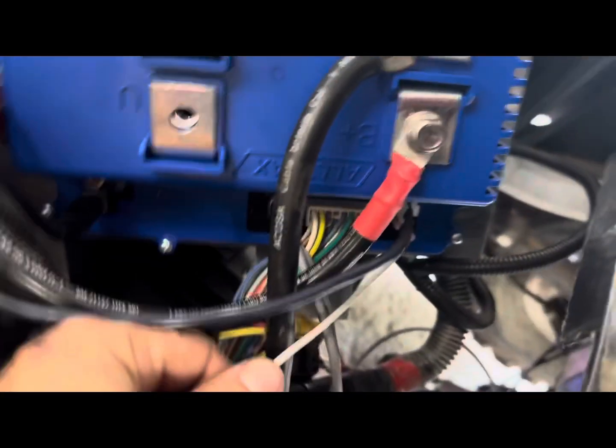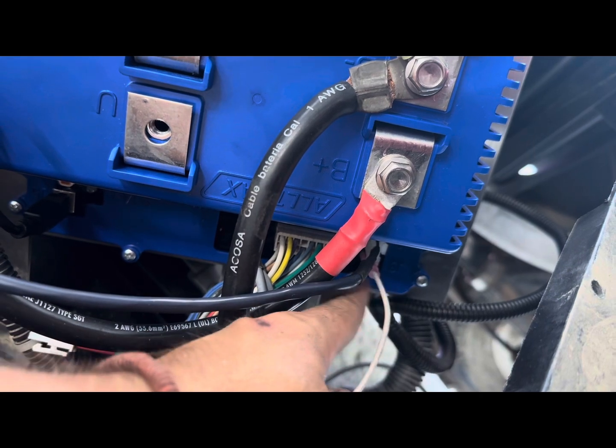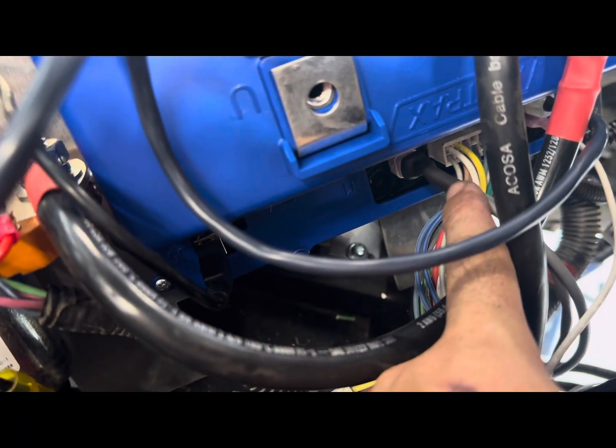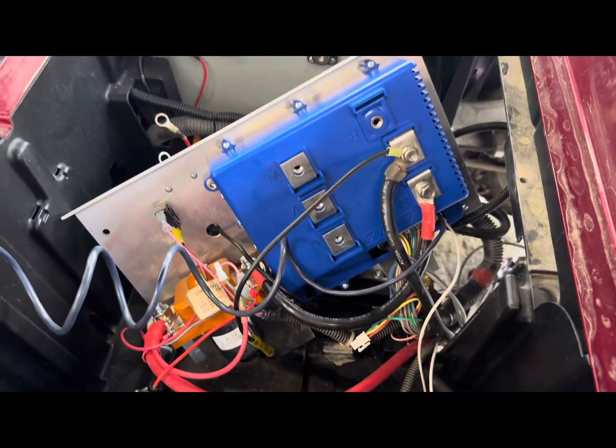The white wire that was attached to the motor ground gets plugged in at J3. This is the on-the-fly control, and I hooked up the 16-pin harness that is stock right there. That's pretty self-explanatory — that's the speed sensor. Now we're ready to put everything together.